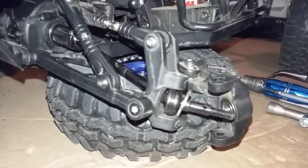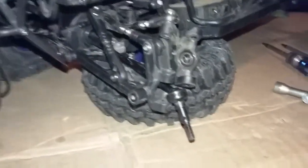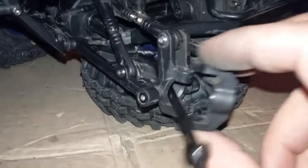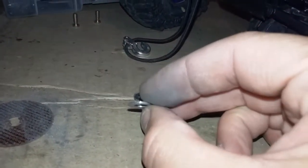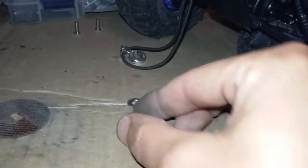Give me one minute to slap this back together. I've literally taken this front end apart — the king pins and steering knuckle — on and off about 20 times since the last time I hit the pause button. My washers are all drilled out but they're just a little bit too thick, so I've been using this little cutoff wheel as a sanding disc and just removing metal off this washer, trying to thin it out a little bit.